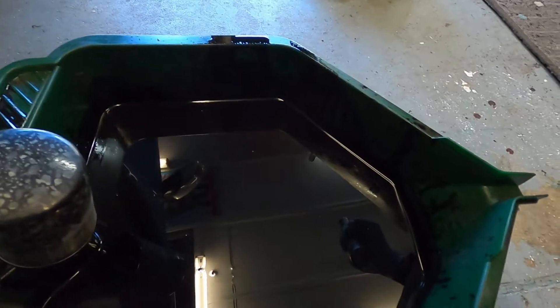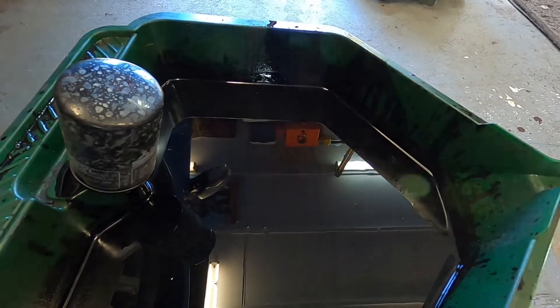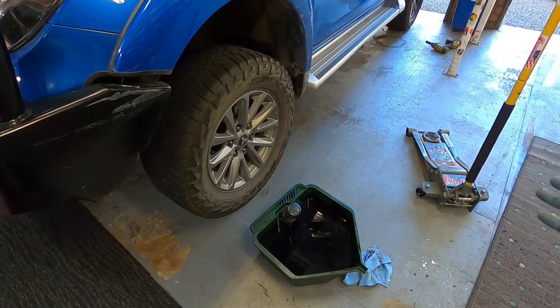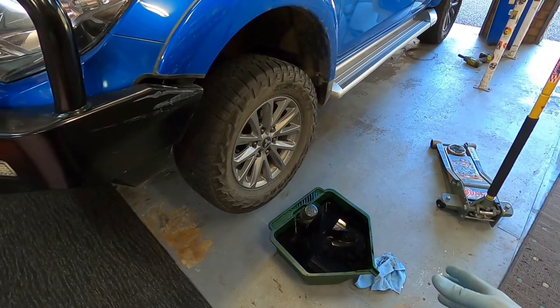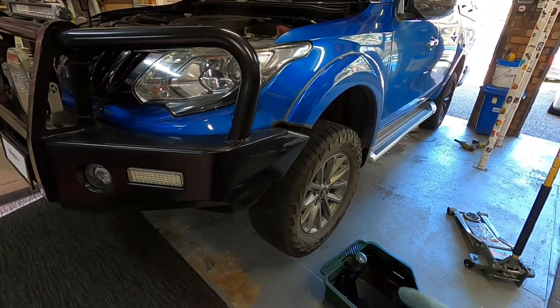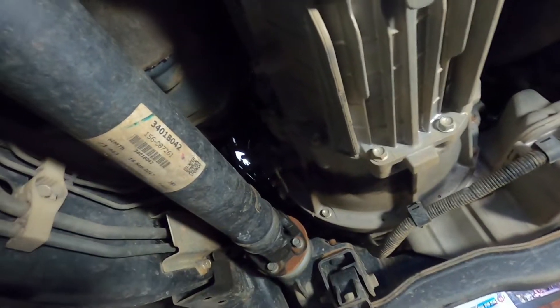Once you've got your oil tray out, it's a good time to tell how healthy your engine is - check how many litres have come out. This one's just under 8 litres, which is pretty much bang on. You should use around about 500-600ml of oil between services, which is pretty standard. Also recycle your oil - put it in the old container and take it to the tip or a recycling centre. We'll drop the car back down to make it a little bit easier to work on.